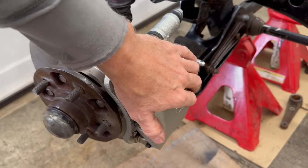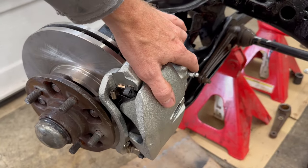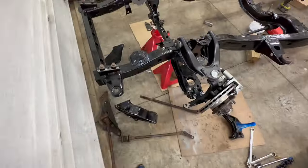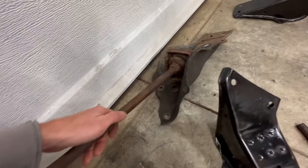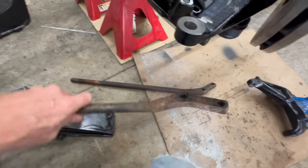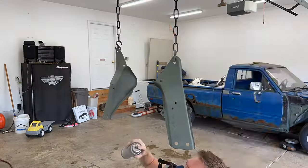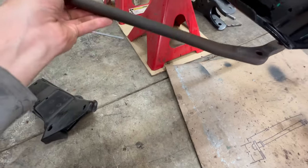The wheel bearings need to match this hub. The rotors and calipers are both from a 1988 one ton pickup — nothing fancy, just a plain one ton non-dually rear pickup. This setup is just a little bit bigger than the factory brakes but it will allow me to retain the factory 14 inch wheels. There is yet one more piece of the puzzle and that is the strut rod. Here's the original from the 1987 I parted out — I needed this part of the rod because these holes fit the newer control arm from the 1991. Here is the original rod from the 1980 and these holes were a little bit too far apart. However this bracket didn't fit the frame of the 1980, so here is my repainted original bracket and that's going to mount up here.